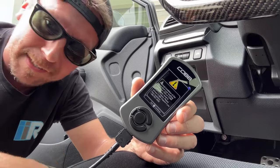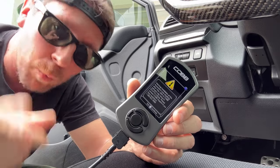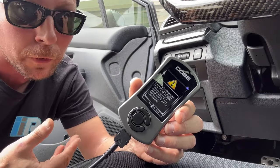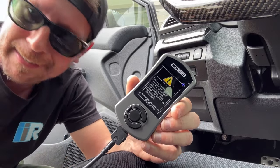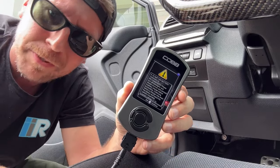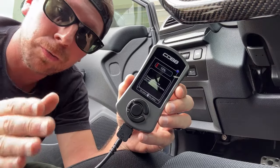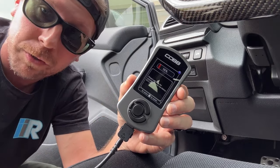In our instance, I know the car is stock and I want to put this tune on, so I'm not worried. Also worth noting: if you ever want to uninstall, the factory tune saved on the ECU will download onto the Accessport, so you can return the car back to stock. I'm not worried about stock — I want to go fast, so I'm hitting OK. As we previously talked about, Cobb highly recommends you have at least a 10-amp battery charger hooked up at the time of the flash. The tune has now started — first we pull the old factory tune off the ECU and store it onto the Accessport, then we install our Stage 1 map onto the ECU.